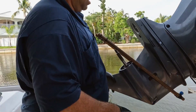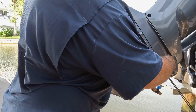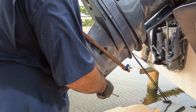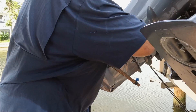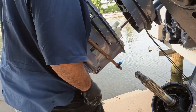When pulling this gear case off, you really don't want to shimmy it or try to move it around to pull it out, because there's a speedo tube built into the gear case where that plastic fitting will break if you try to wobble it out. Just grab a screwdriver and let it work — pry it off, work it in, and eventually it'll come off. You want to come straight down because if you go on an angle you're going to crack this little plastic tube, so save yourself the headache of having to replace it.